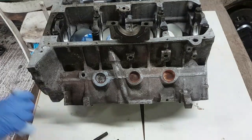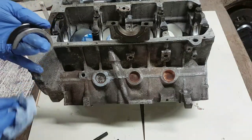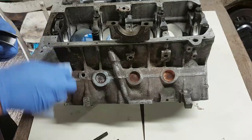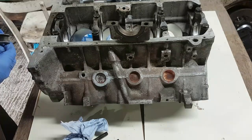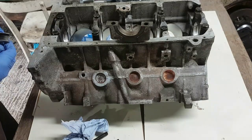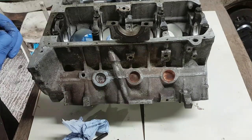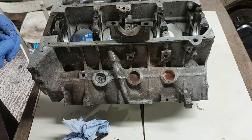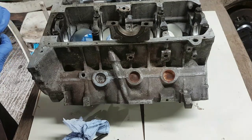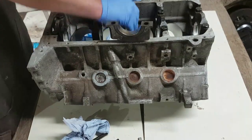And on the back of this bearing here, we should have a make and also a size. Right, there's the make. These are 10 thou. 10 thou undersized. Part number S99565. They're not Vandervell like the big end bearings are, but they're not bad. So it's just a case now of